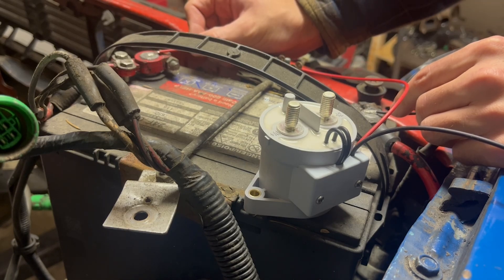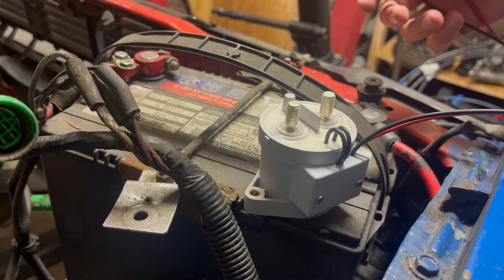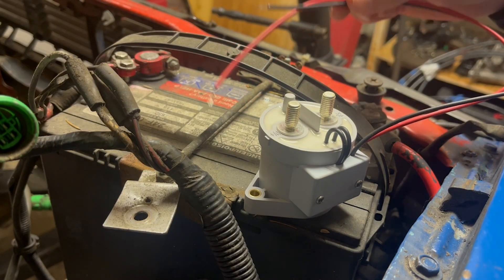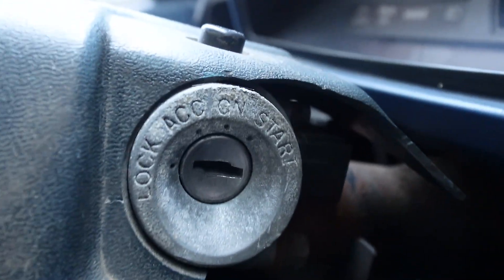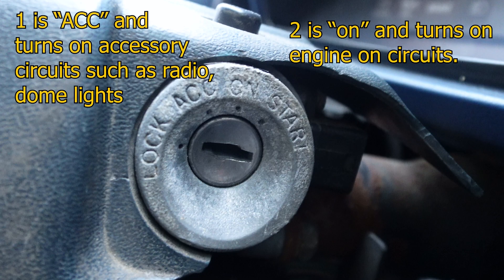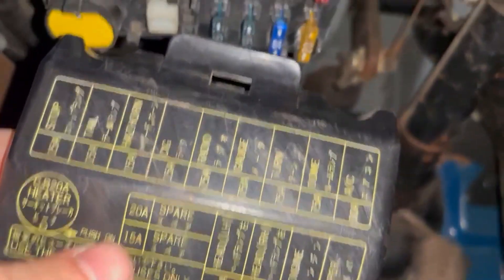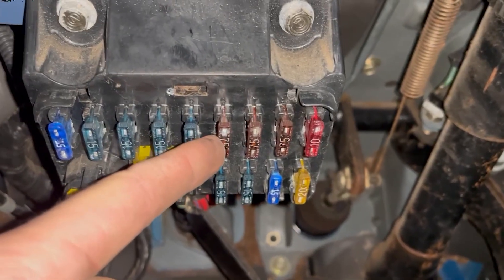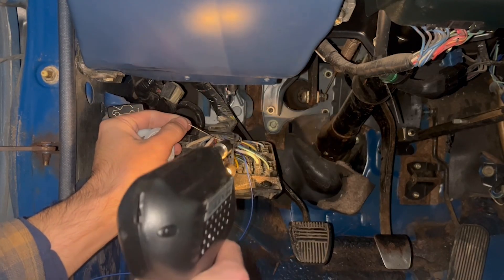This interrupts the high-voltage system so that when the car is off, the controller doesn't get power and therefore the motor can't get power. The signal wires are going to be wired to the engine-on circuit so that when you turn your key on, the high-voltage system is on. Your ignition has accessory (position one) and run (position two). You just tap into the existing run circuit in the fuse box — I chose the fuse labeled Engine On. The two beefy leads on the contactor connect to B+ on the high-voltage pack and on the controller.